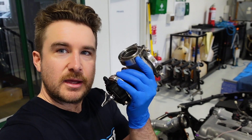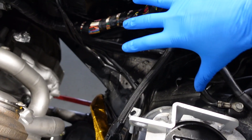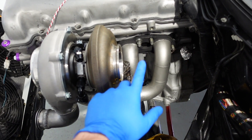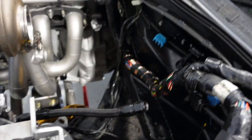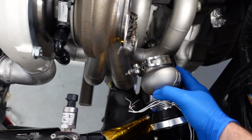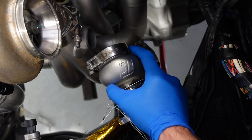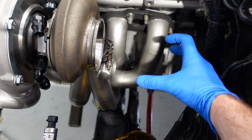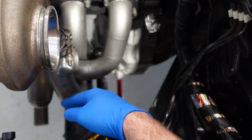We're having a look at how we're going to fit the wastegate in the car. This is the outlet on the exhaust manifold for the wastegate. Currently we've got the battery mounted in here, but we're worried about cooking it — there's going to be a lot of heat in this area, and even with shielding it'll be really difficult to keep the temperature away from the battery. So we'll move the battery into the passenger compartment, which frees up room to fit the wastegate more neatly here. We can point the outlet down underneath the car, though we'll need some bends cut up to make sure we're not going to interfere with the wastegate outlet.